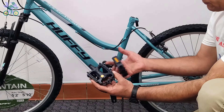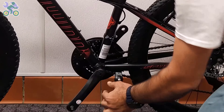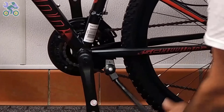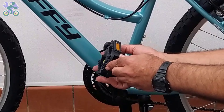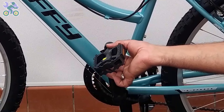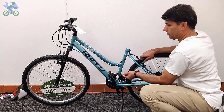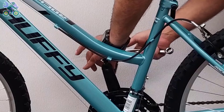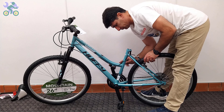To install the pedals, find the right side by checking the letters R or L labeled on the pedals. If there is no label, look for engraved letters on the bottom of the metal part. If the chain has come off the sprocket, reinstall it by placing it on the sprocket with your thumb and turning the pedal once. Install the pedal by hand only, without touching the threads and without using tools. Be careful to install the pedal vertically on the crank arm to avoid damage to the pedal and crank threads. For the left side, turn it counterclockwise — or the easy way, turn it toward the front of the bike. After making sure the pedal is in the correct position, turn it a few times by hand, then while holding the rear wheel, use a 15mm wrench to tighten it.